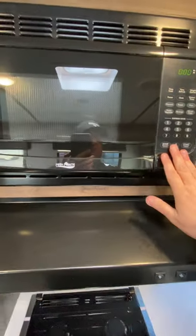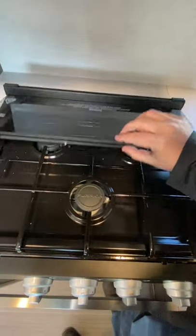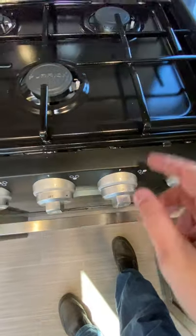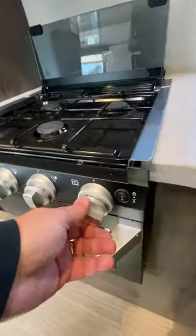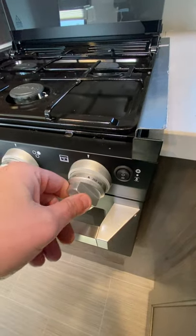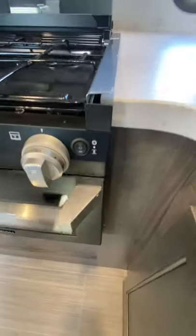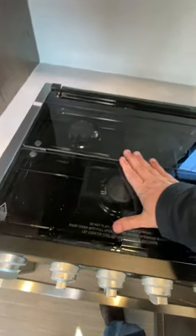Your microwave — obviously you're going to have to be plugged in for that; it operates just like what you have at home. Your gas stovetop and oven — it just folds away like that. Three middle knobs are going to be for the individual burners. And then on the end here, this is a spark ignition, kind of like you would have on a grill. On the other end, this is going to be for the oven. You can just do pilot, crank, and then continue on to whatever setting you want. And then the dial on the end is just for a little bit of backlighting if you want that on. Fold and fold down into place.